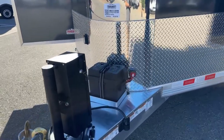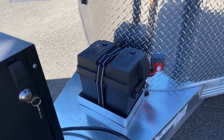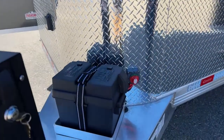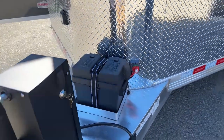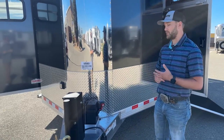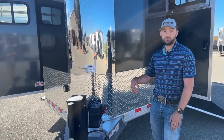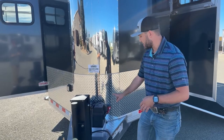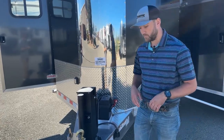Our battery power for this trailer — we do have a battery mounted to our gooseneck coupler deck right here. That is going to power your air ride while you're traveling, your interior lights, and your exterior lights. You don't have to be hooked to your truck to run this. Anything we throw a battery on, we are going to put a disconnect switch on for you guys. That serves the purpose of: if you're unhooking this trailer and done using it for a few days, you don't have to worry about if you left a light on somewhere. Flick that switch and it kills all the power to the trailer. If you flick it to red when you get where you're going, when you go to hook back up, your batteries aren't dead — just click it back to green. It also allows you to charge this battery while you're traveling, so always have that on when you're hooked up.